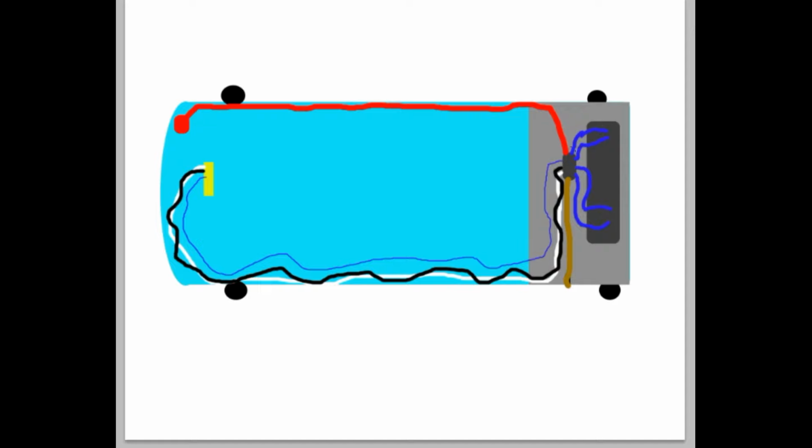And then back here you have your speaker wire, a positive and a negative running from one sub to the positive and the negative on the amp for the speaker terminals, and then a positive and a negative for the other subwoofer running to, say, channel 2 or channel 1, whichever way you have it, onto your amp. Now, like I said, if you have a mono amp, there will normally only be 2 terminals. Say if you wanted to hook up 4 subs, you could do that, and it would just split it, and you would run all those wires to the same one. You'd run all the positives in one terminal and all the negatives into the other terminal for the speaker.